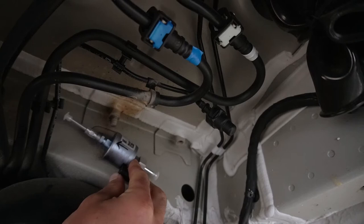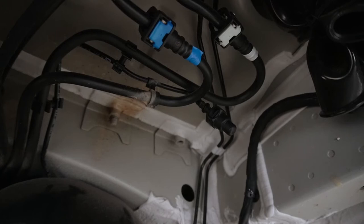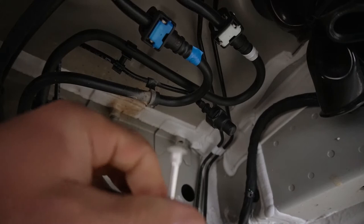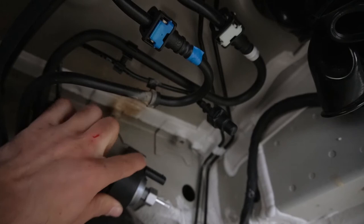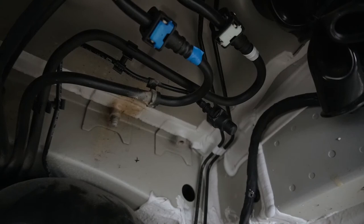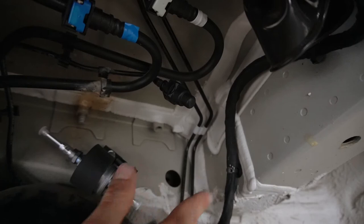And so it comes with a little mount, a little clamp, a holding mount. It's rubber, so just be careful installing it. Let me put it right here. So I need to go drill a hole real quick, and then I can run the wire and snap it in. Yeah, it looks good. Okay, so I'll put it right there. I can go in between there and there. Do a little pilot hole, and then I'll use a big self-tapper that I've got to just lock that in place. So I like the way that looks, my connection. I can put a little loop, curve it into there.